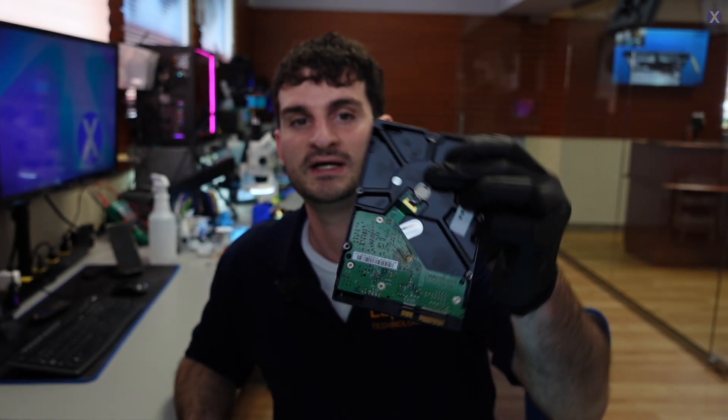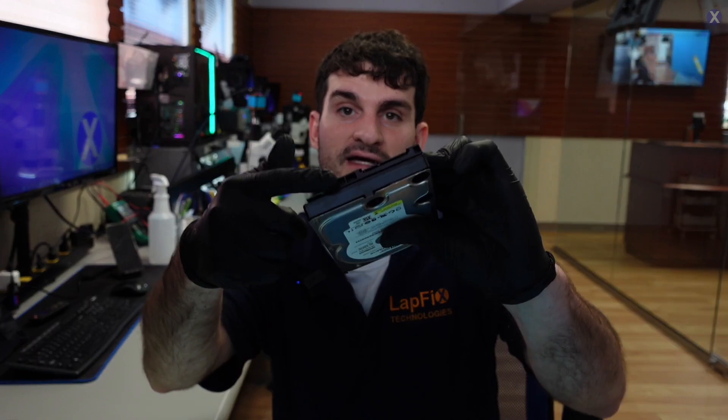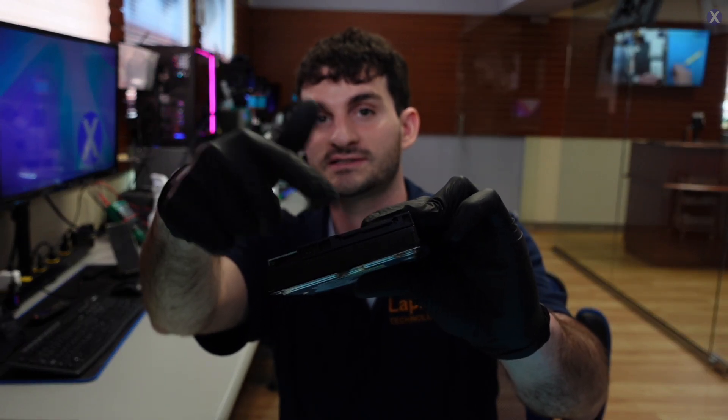This may be a little bit different if you have one of the smaller Western Digital drives, because those have a USB board — basically a board with a USB interface and not a SATA interface — which is a lot more difficult because to communicate with the drive itself you need to convert it to a SATA connection. We have a whole video explaining that.